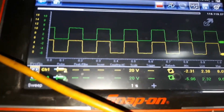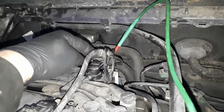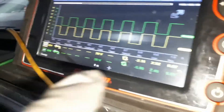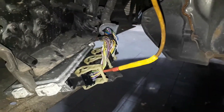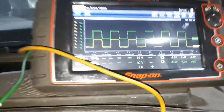I just want to show you this — it's a very quick way of finding if you have an ECM problem or a wiring problem. All you have to do is back-probe the signal wire coming from the sensor. If it's a nice zero to five volt signal, then do the same check at the ECM input. I also checked the pin grab and pin tension — removed the connector with a proper pin tool, all checked out, no corrosion, no other issues. So we've got a faulty ECM. Thanks very much for watching and I'll see you on my next video.